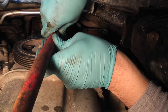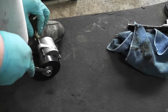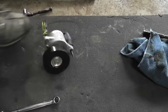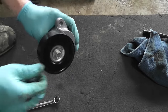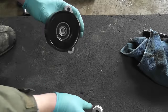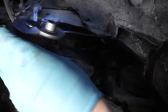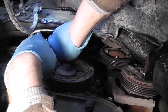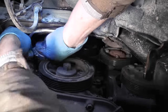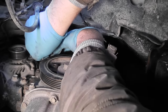The other pulley is back in place. To reinstall the tensioner, I'm going to take off the pulley of the tensioner first — this will make it easier to install the tensioner back onto the car. Slide the tensioner back in place; the aluminum pipe is not in the way anymore since I broke the retaining clip, and I'm not going to worry about it too much. Screwing back the bottom 12mm bolt.